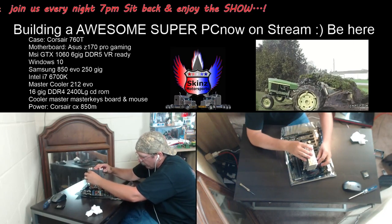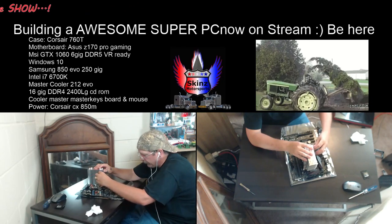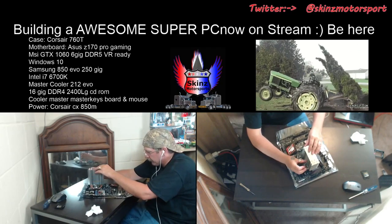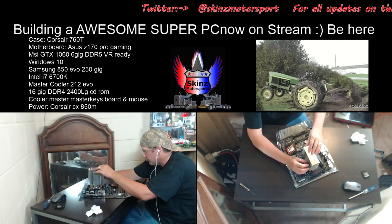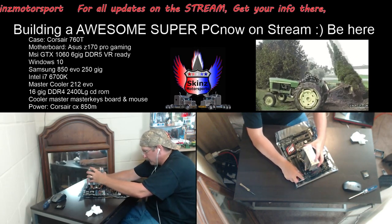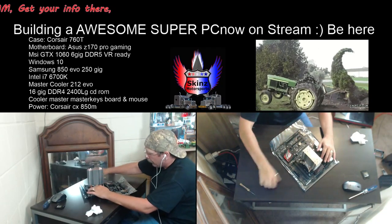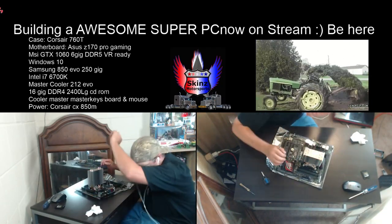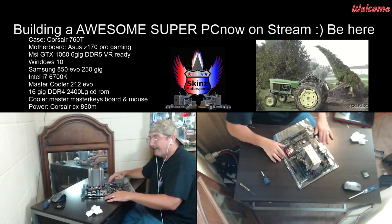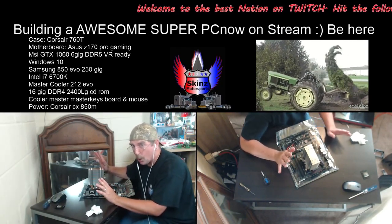Going opposite corner across, and opposite corner. Our master cooler now is firmly on the processor with the dabbed thermal paste and it doesn't move. Okay. That's all you need to do. Do not over tighten your screws.